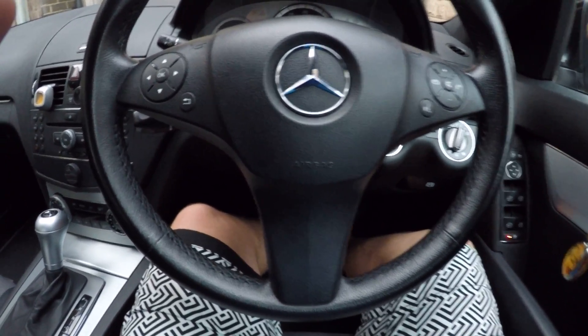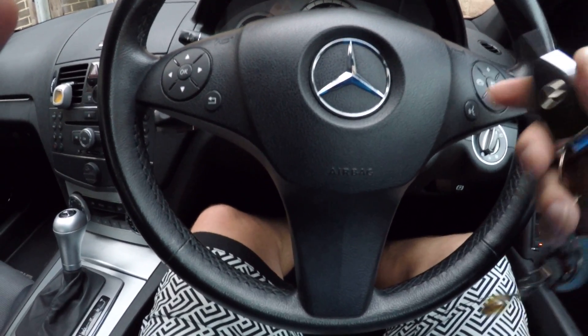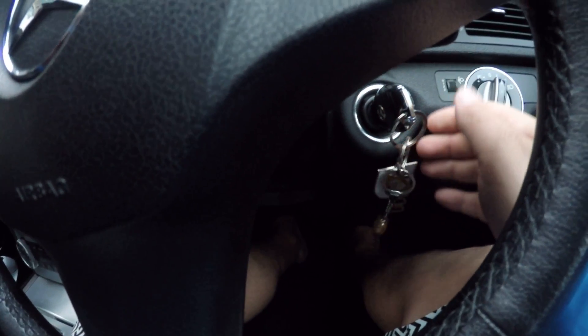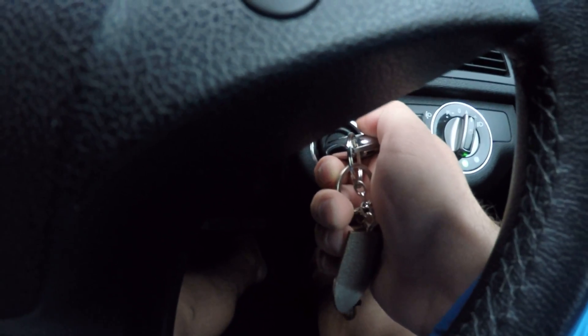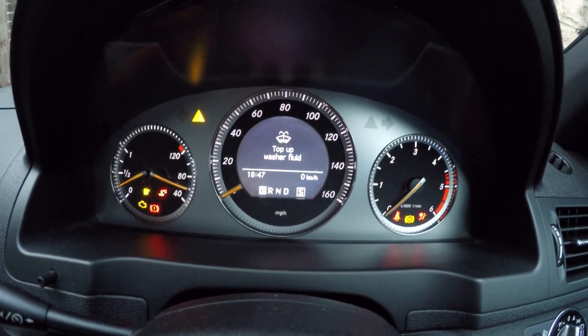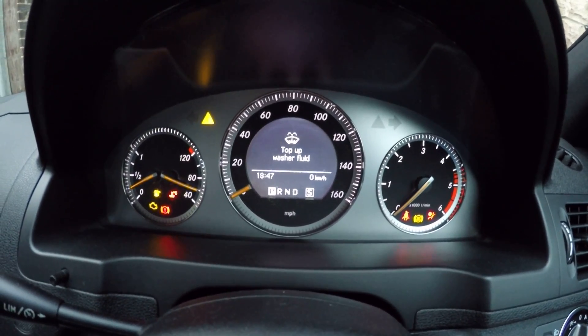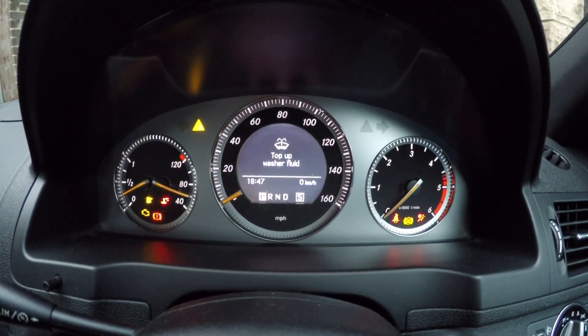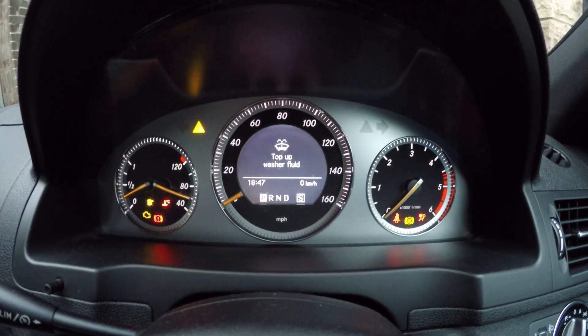So it's quite easy — all you need is to get your kit, set this kit, put in the ignition, turn the ignition on but don't start your car, so all your lights should come on. Press the accelerator pedal to the maximum and wait for 15 or more seconds.